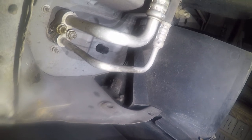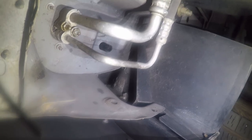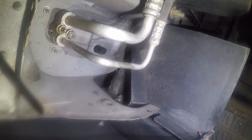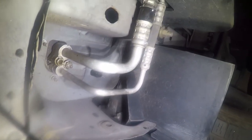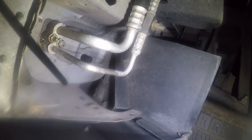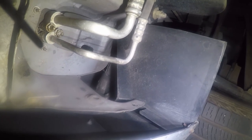Now that it's changed, the rear battery air conditioner works like a champ. You have to wonder how long that's been bad. I mean, it is just going to town air conditioning that battery, which means that the hybrid mode actually might start to work like it's supposed to and give great gas mileage. So that's really, really exciting. At first I thought it might be something really horrible, like a leak of refrigerant oil, but it's not. It is water coming out of the condensation tube, and that's what should be happening.